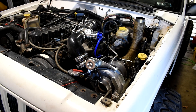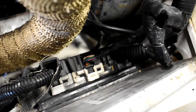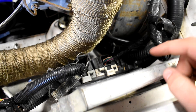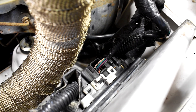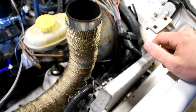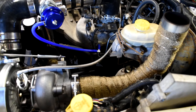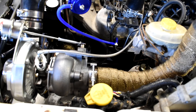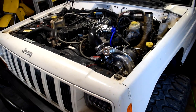For tuning — that's the biggest question I've gotten. Split Second Tuning makes a fuel and timing calibrator that piggybacks straight from the black plug on your ECU. You plug in the Split Second tuner and then into your PCM, and the existing wire goes on to the other side of the harness of the Split Second module. It is pricey up front, but it is plug-and-play for these Jeeps. It takes care of timing and fuel under boost and comes pre-built with a two-bar MAP sensor, so it takes care of your MAP issues.